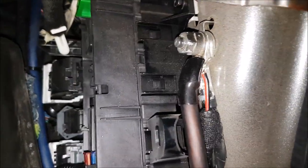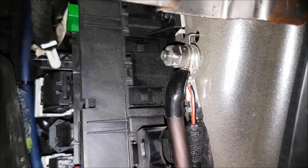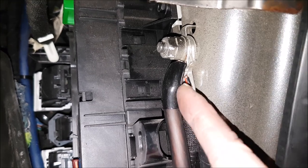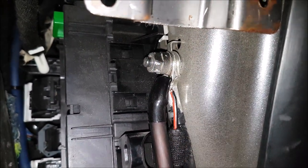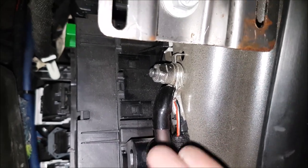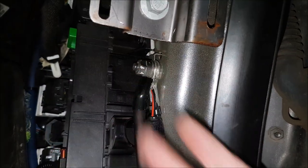So this is the next alternative and what we typically do on these trucks. Instead of selling them two power kits or a lot of extra wire to go all the way to the battery, if we're not dealing with super high amperage, we can just run a slightly longer ground from the factory stud over here. What I like about the stud is it's factory — they've tested it, it's proven, and it's way up high — so even if there's a bunch of water from boots or whatever, it's never going to have an issue.